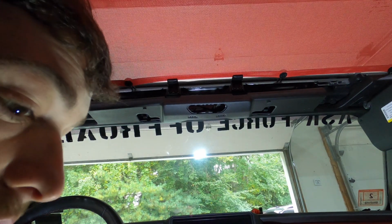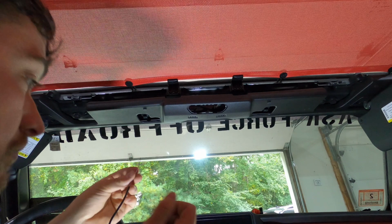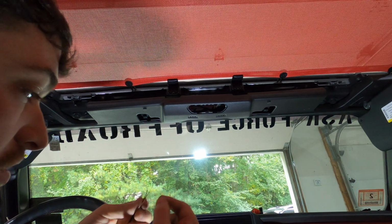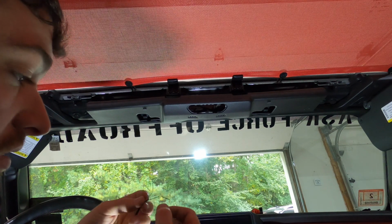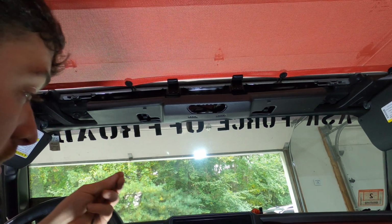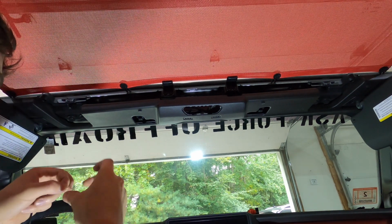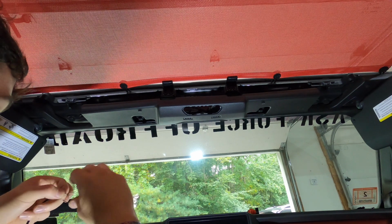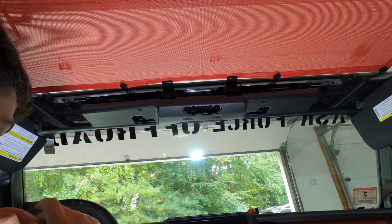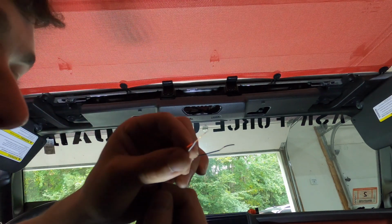Alright, so now I'm making the wiring harness for the back of our switches. White should be our switch. Red is our power, black's our ground. It's only gonna be running when the car's on, so we're just gonna tie red and white together. I know this stuff doesn't need a lot of power, it doesn't draw a lot, but I hate when wires are this small. It's so frail and so difficult to work with. So I'm gonna leave it like that.